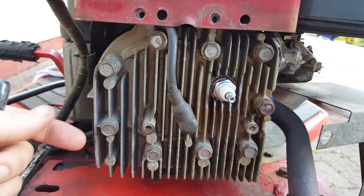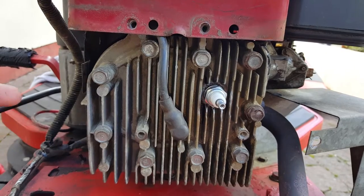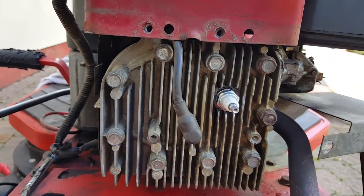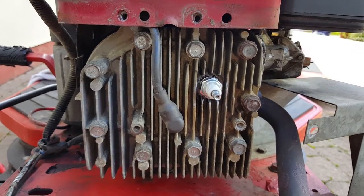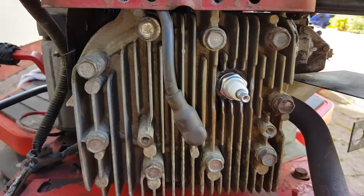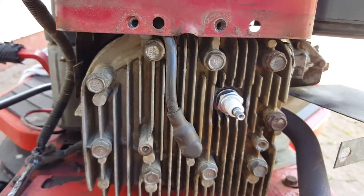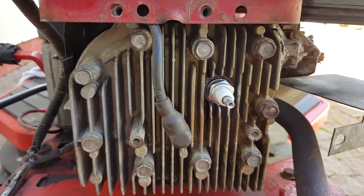So in fact I had to do what I didn't want to do: take the head off. All I done was heat it up, undo the bolts, then give it a light little tap so you don't split the old head gasket. This engine is from '93, so it's done a lot of work. I installed the little insert after threading it, mounting the whole head on the bench to thread it.